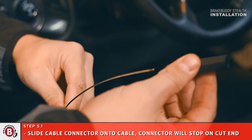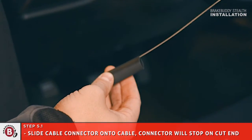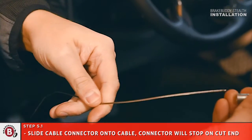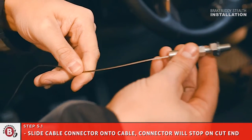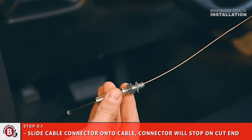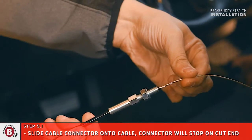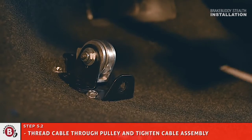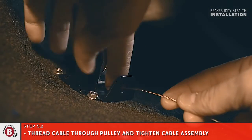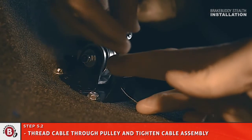For our next step, slide heat shrink, then the cable connector onto the cable. The cable connector will stop on the newly cut end. Thread the steel cable through the pulley and tighten the cable assembly onto the bracket with 2 5/16 nuts and 2 5/16 lock washers.